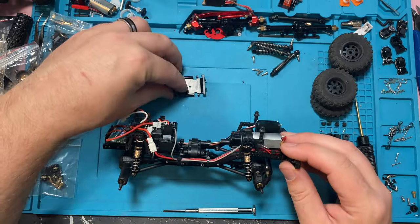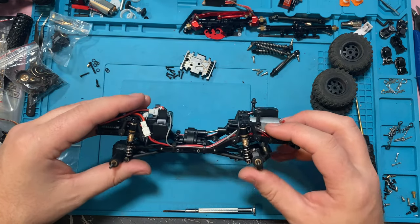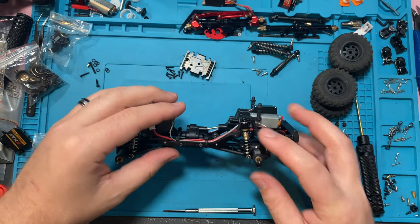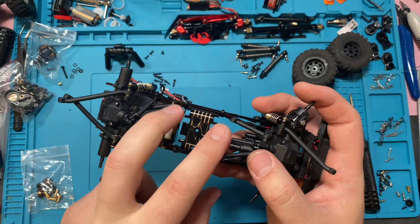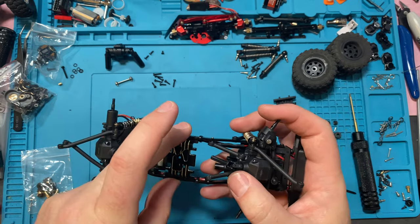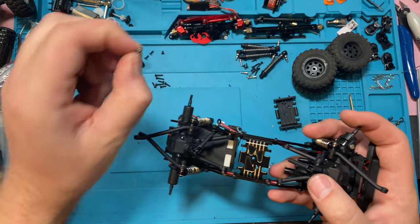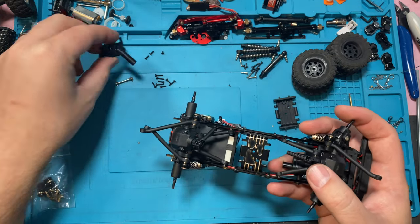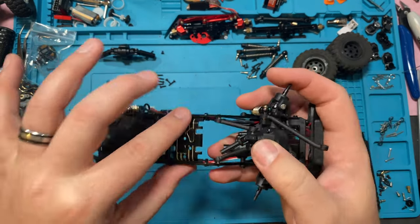So we're going to go ahead and install the brass belly plate now. Got the shocks all in. Seems good. Brass belly plate. So getting the new belly plate in there is pretty easy. It's just the four screws from the links to pop the links out, and then four screws from the side rails. The new belly plate comes with all hex screws for that, so that's nice. The only screws you have to use are the transmission screws. There's three transmission screws, and you'll use your stock Phillips heads for those. So it's pretty easy, and it looks cool.